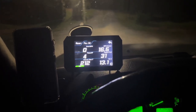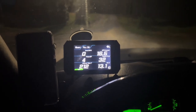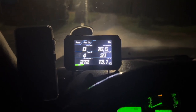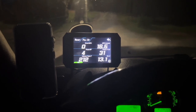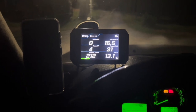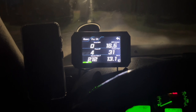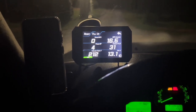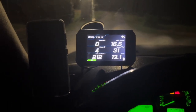Because prior to me applying pressure, nothing was leaking. It was just running normally. But when that pressure was applied at 15 PSI, the leak opened up and it started leaking on the side of the radiator. But it wasn't bad. It would hiss a little bit and get quieter, hiss a little bit, get quieter, until the hiss just basically quit completely. And then it sealed up and the water dried up, because I was working on it for such a long time that there were no more water leaks at all.